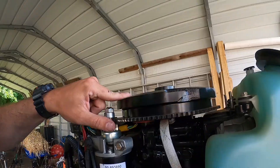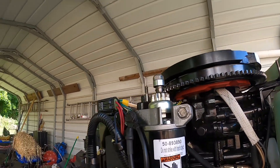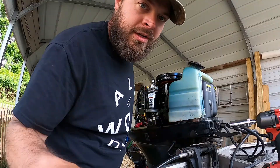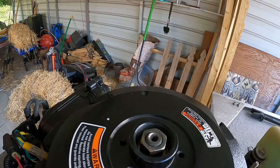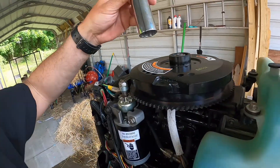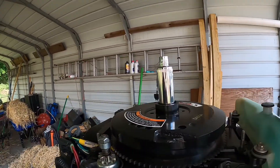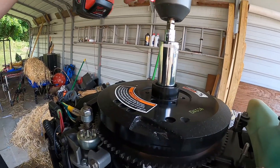This is your flywheel, this is your stator. We went with an aftermarket one and it came with a pretty awesome little instruction booklet that even gives you a test to run through to make sure your stator is actually the problem — because the only other thing it can be is your voltage regulator. Next step: there's a nut at the top of the flywheel with a washer below it. You will need a 24 millimeter socket, and I suggest an impact wrench because it's pretty hard to keep the flywheel still while running that big of a bolt off.